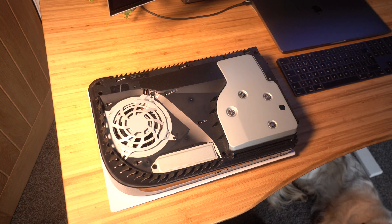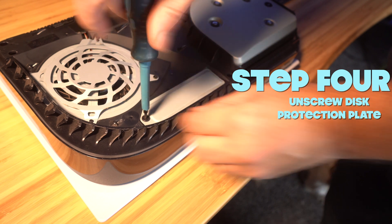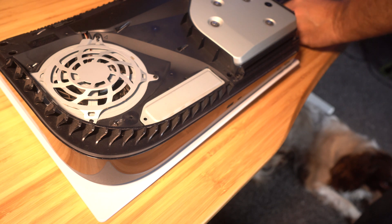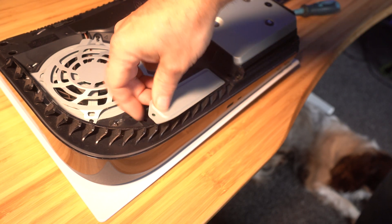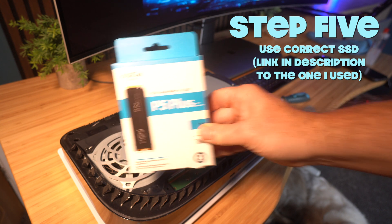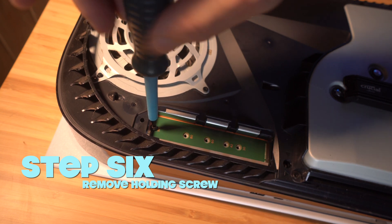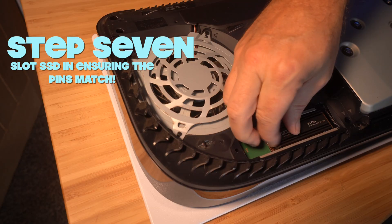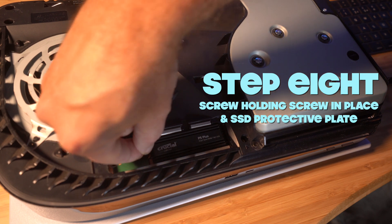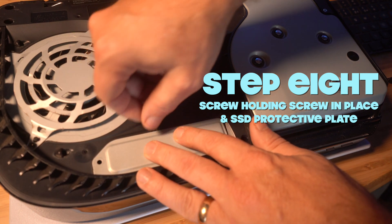You don't need to put too much pressure on at all. The next thing you need to do is remove the case housing the SSD drive, or where the SSD drive is going to go. That's simply one Phillips screw. Take off that plate and you'll see the drive entry. I'm using the Crucial 2TB M2 drive, and you need to remove the holding screw because we'll need that in a second. Slot the drive straight in and then with the holding screw, just screw that back into place. And that's it, pretty much done. You'll then need to put the plate back on so that it's protected.